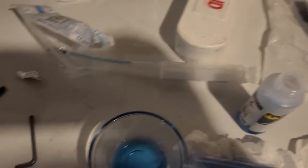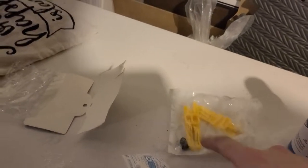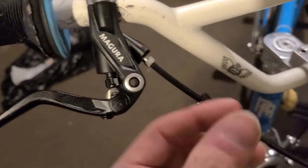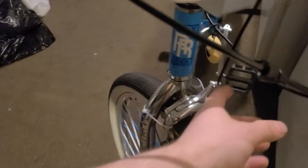I also got this extra bottle of Royal Blood hydraulic disc brake fluid. The kit comes with two syringes, the plungers, and then for disc brakes you put these in as you're doing the bleed when you take your wheels off. It also comes with these two extra olives — these are for the housing on the disc brake hose. You put that in, slide the olive over, and there's a little nut that goes on there. You put that on and tighten that up. For this rim brake line, you would only put the olive on, slide that in, screw it on with the bolt, and put this back on.